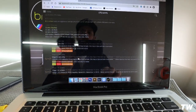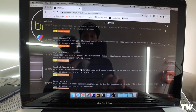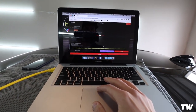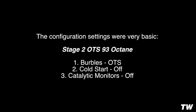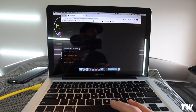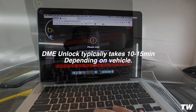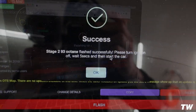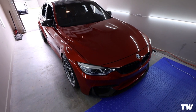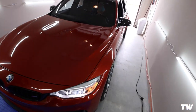Under OTS maps you can see they have a lot of different options for the S55. We made all the changes we want — he's going to do a Stage 2, 93 octane map. When you first flash it you have to unlock the DME, but you'll never have to do that again. From here on out it's really simple. We just flashed Stage 2 on his M3. I was explaining to him how to use everything — it's really straightforward with Bootmod3. From here on out he'll just be using the app.